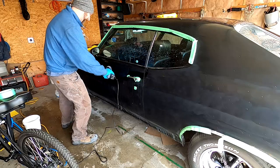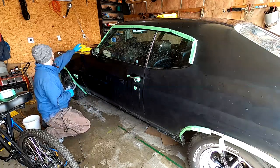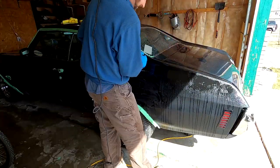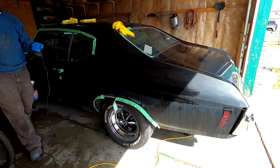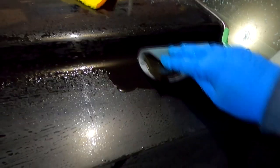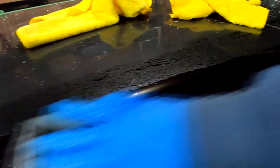Once I went over the car with 3000 grit Trizac pads, I moved on to the 5000 grit Trizac pads and sanded the car again. On areas I couldn't safely use the machine, I sanded by hand. I also made more of an effort to dunk the sanding paper in water more frequently to keep the pads clean. The goal is to make a smoother, more uniform surface once sanded, and the dual action machine certainly made achieving that goal at least somewhat attainable.